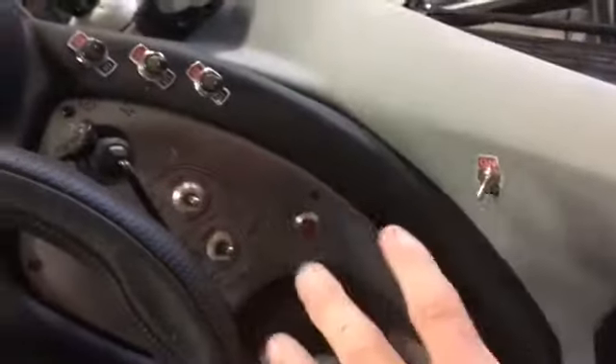So I got that wire tucked in there pretty good — you can't see it, but it runs up in here and then under; there's a hole in the console right there and it runs up in there. Very simple. I did take this panel loose only because I was afraid of moving linkage behind the shifter — I didn't want a wire rubbing back and forth on it. I don't recommend doing it; it is a pain in the rear end. I had to take the shifter off and everything. I would just take something and fish it through. This panel here is only about six screws and it pops out, so you can stick your hand in and access the panel underneath where I have my box mounted, drop that out, and you have access to all the wiring underneath.